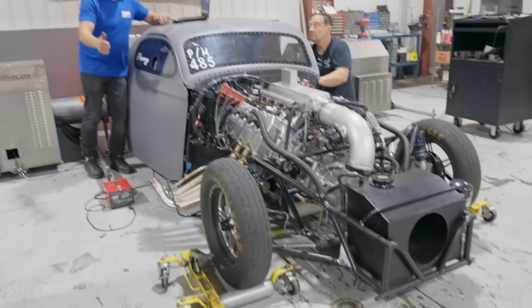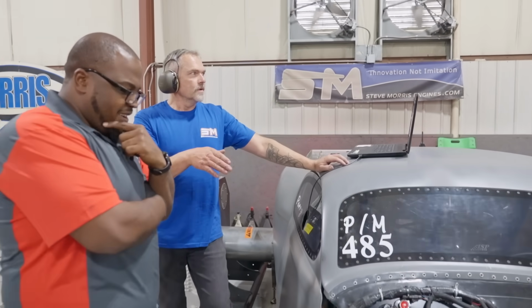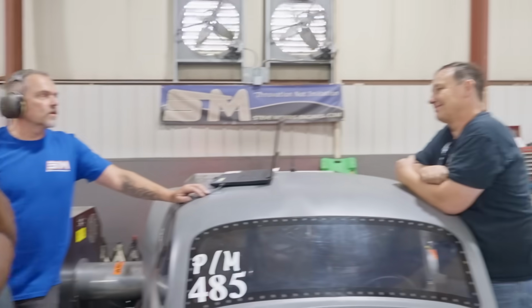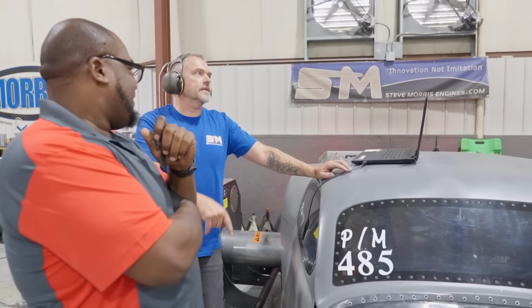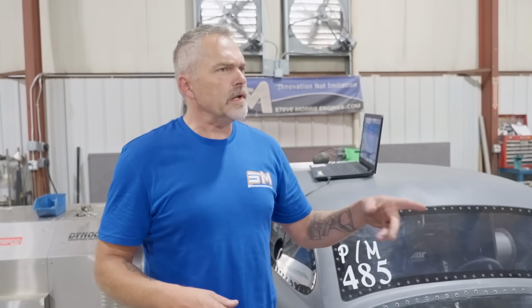So it's live now. All right, so which means that other injector's dead. So let's take that injector back off. We got to take that injector out and figure out what's wrong with it. First time we fired this up, we worked on a cranking fuel table for it. Cranks, fires up now. Seems to be fine there. You didn't even give it any throttle, did you? Or did a little bit. Just look. Yeah, cool. Okay.